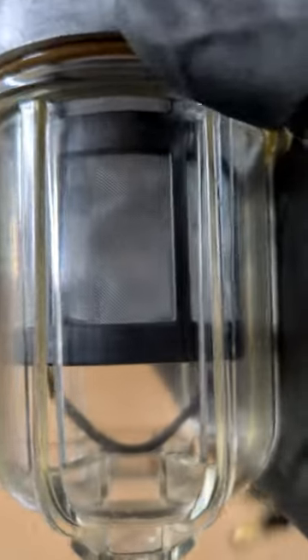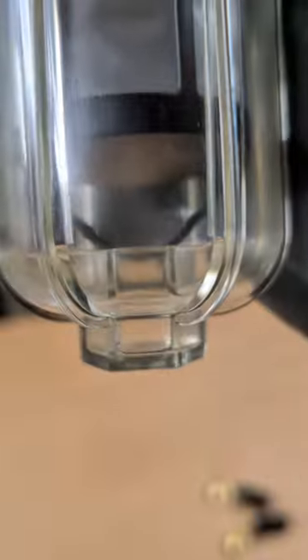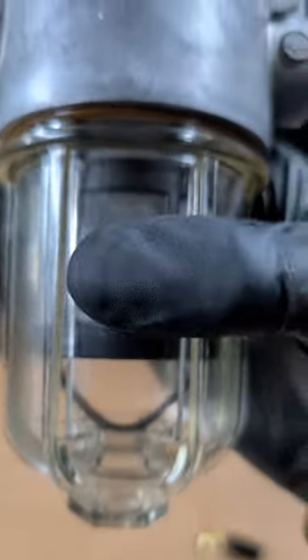This is just a pre-screen, so this goes on the suction side of your fuel system. It's not a filter element, so it's not going to restrict the flow of the fuel. You have a lot of room underneath that screen for the sediment to fall into, and it actually falls away from the screen.